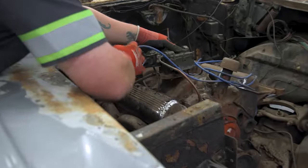We're going to hurry and get this all cleaned up, lower the car, and figure out how to take that steering gear off the steering column. I'm going to cut this steering shaft off because on these 57 Chevys, you pull the entire rod out of the column. We're just going to cut it and then make a double D on the end of it and put the new box in. It didn't hit my foot luckily, but we cut it off.